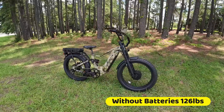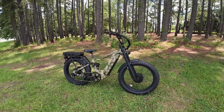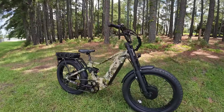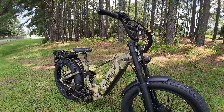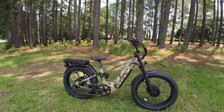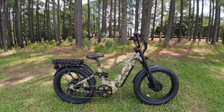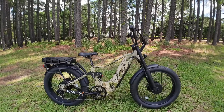Keep that in mind if you're going to be lifting this bike or loading it onto a truck or a bike rack — it is very heavy. The batteries are made with Samsung S cells, which are high-discharge cells. When you've got a bike pulling this much power out of the battery packs at once, you've got to have a battery management system that can handle that huge discharge rate.